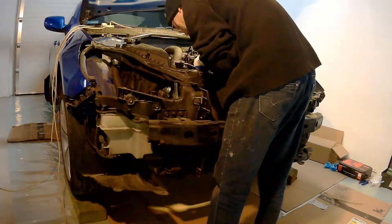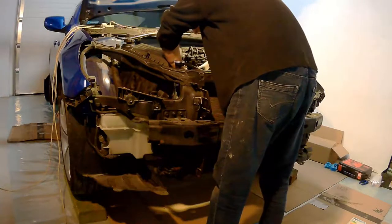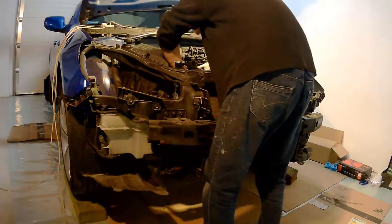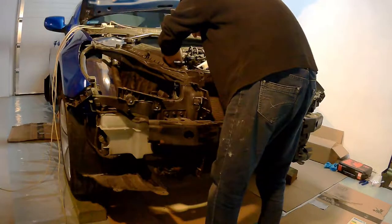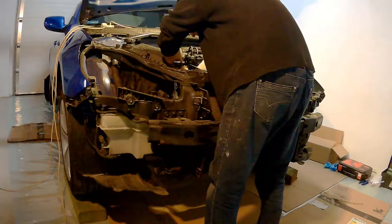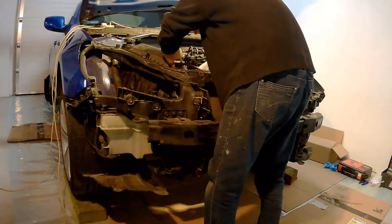I mean, you can see easier if you have the whole front removed. And it's actually not that much work to remove it, because Hyundai conveniently provided a disconnect point for the harnesses for the front. Essentially the lamps and the bumper just easily disconnect. And then there's like two or four bolts for one side, and the whole support goes out as one element. Taking out the bumper, the support, the headlamps, it all takes maybe 3 hours or so, maybe even less, if you're not in a hurry, right?